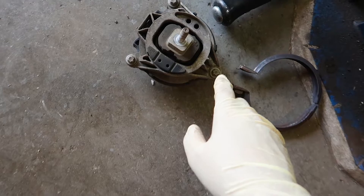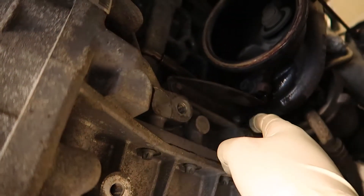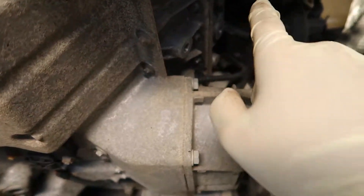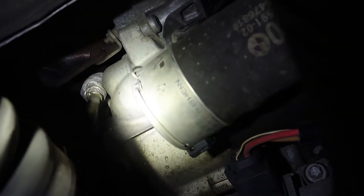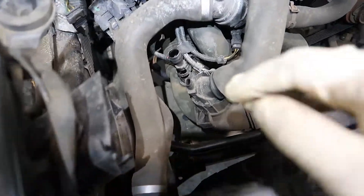To take the motor mount out, you just have three bolts — one, two, and three. Now loosen up these two E10s, one there and one there. There's also a T50 for this clamp here. Then we'll move to the front to remove the charge pipe and inlet. You can see the charge pipe is now off — I used a long pick to pull that clamp off. There is a 10mm nut for the inlet pipe, so we'll go ahead and remove that.